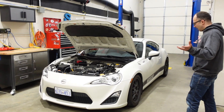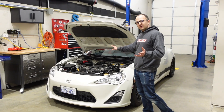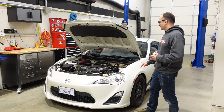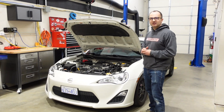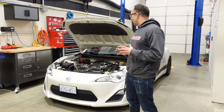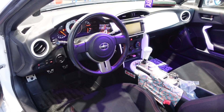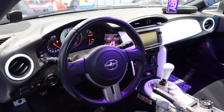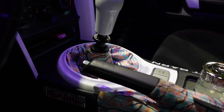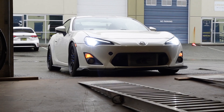It is rear-wheel drive, limited slip, manual transmission, low weight, and this 2 liter — in the case of the gen 1 — DI engine with both port and direct injection. Some of the things that are really good about this car is its ability to be modified. It's almost like Subaru designed this with modification in mind. They put in two sets of injectors so you don't have to add anything more to increase your fueling headroom.